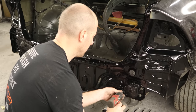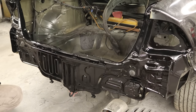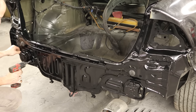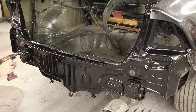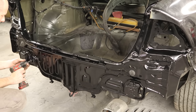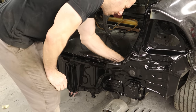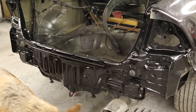Start all the bolts before we tighten them up, then go over the other side and do the same thing. Looks like the supervisor is patrolling to make sure I'm still working. Luckily she didn't catch me taking my little nap on the creeper. There's a little rust in those threads — that's our frame rail from Ohio — so we'll run it back and forth and clean up the threads a little bit. No torque specs required if you give it the little tap.